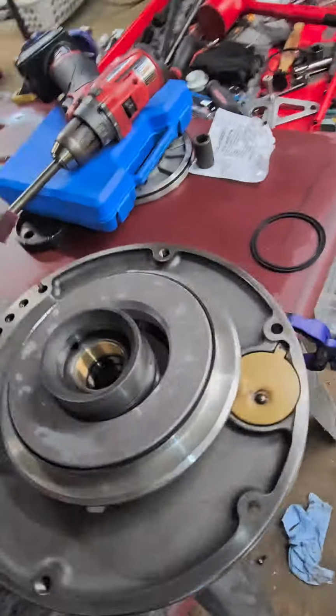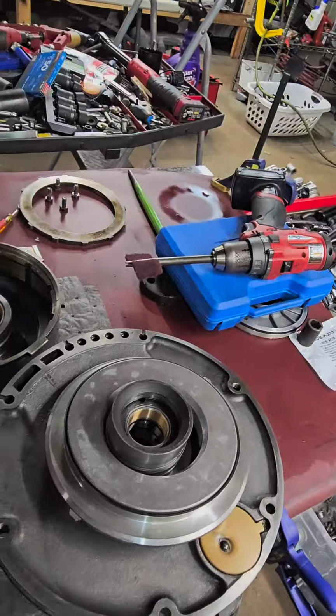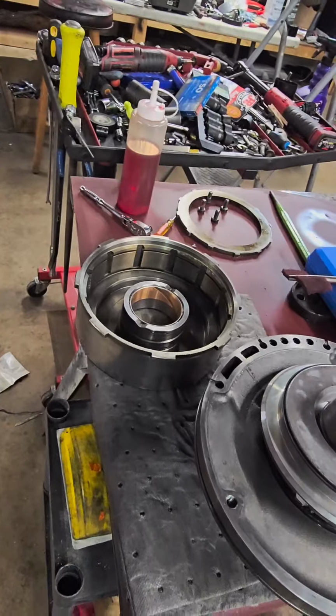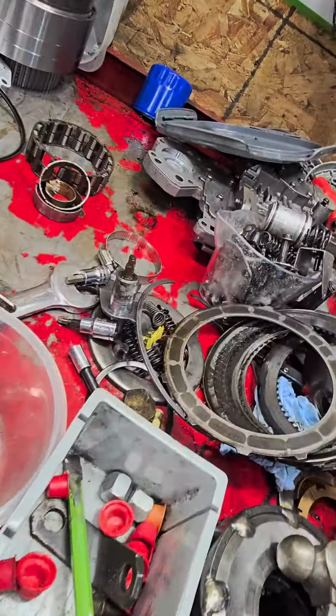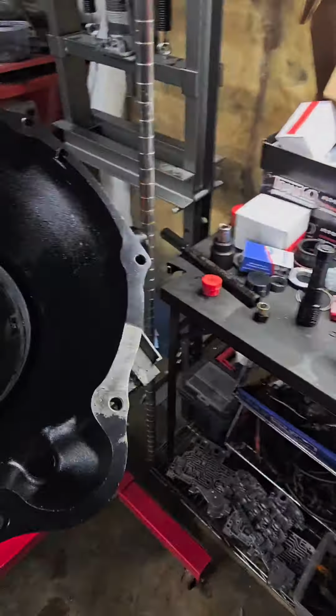Just wanted to show you guys that before I forget, because if you accidentally put that little fucker in there and you got a 185-plus psi valve body, you're gonna have all sorts of third gear flares. It's gonna burn up the third gear clutches like this guy did, probably. That's probably what he had in there. I didn't even look. So yeah, we're moving right along, y'all.